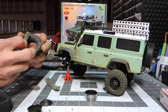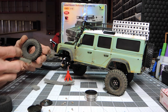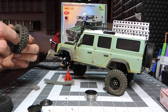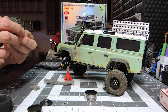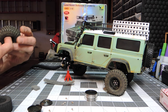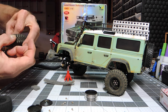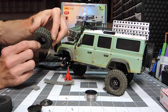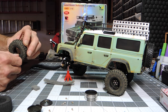As you can see, this strip isn't going to completely reach the full circumference of the tire, so I have a couple other pieces here that I can cut — little pieces to sort of fill in. It's not going to matter because once the foam is inside, it keeps everything in place. You don't have to worry about anything shifting around — I've done this mod quite a bit to other tires in the past, and when I say that it doesn't move around, it definitely does not move around. These two materials sitting next to each other, they stay put. Once everything's in there and you push it around to the outside of the tire, you can gauge how much you're going to need to fill that in.